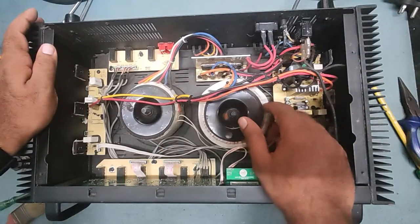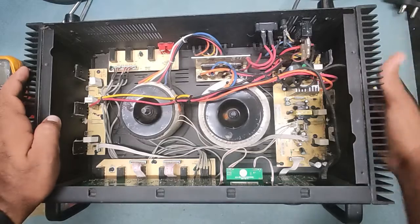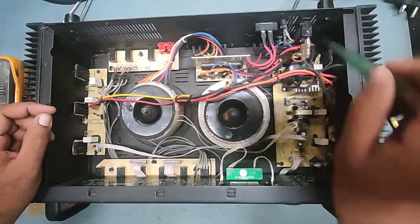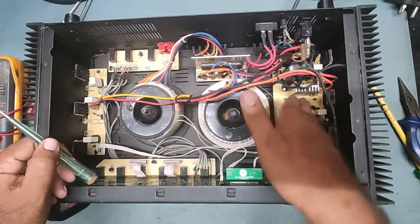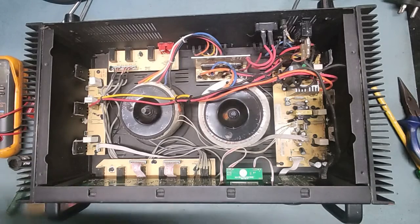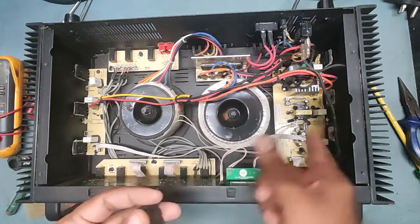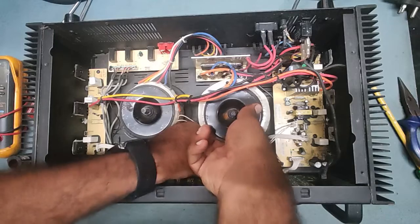I have already cleaned with the blower. Now we will remove the screws — three screws on top, three on the bottom — and then remove these six screws on the heat sink so it comes out. We need to replace these two transistors. This is an NPN transistor — the new one is a C5200 NPN transistor. We'll put two new transistors in, solder them, and check if the sound is coming.